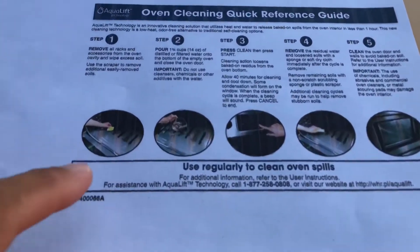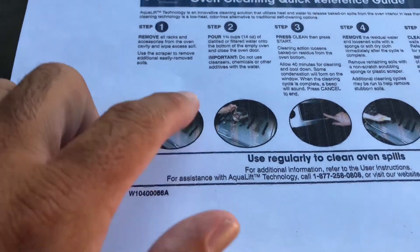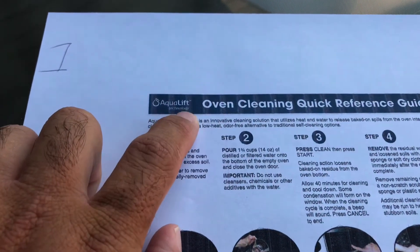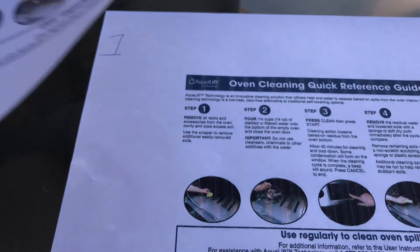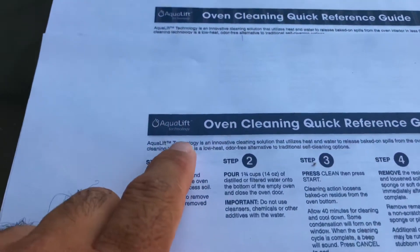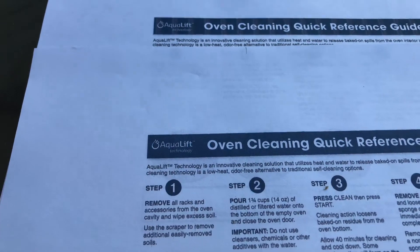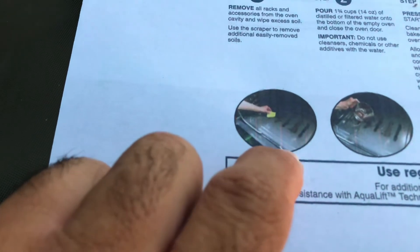I don't need it for professional pictures, just for printing out forms like this. So the test print I had here — here it is, the first one. It's not supposed to have these lines. This one has the vertical lines. You can see up here — this is supposed to be all blue, but you can see these vertical lines. Now after four cleanings I went through, this is what it looks like now. The top header looks better — you can barely see the vertical lines — but you can still see it down here. Look at that — some of that magenta is coming through.